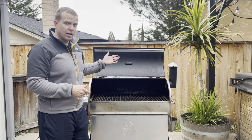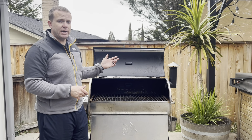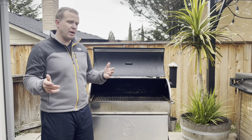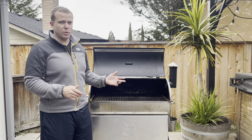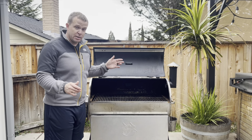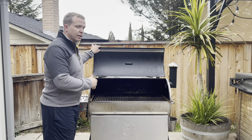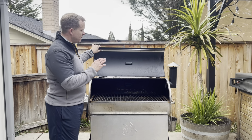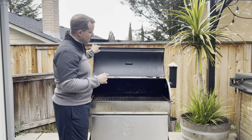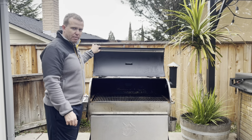But as you can see here, the RTV itself will do a very good job of holding that drip edge in place. So if you don't have a neighbor or anybody like that that wants to come over, give you a hand, one of your family members, that's fine. You should be able to accomplish this with one person. Just take a little bit of care as you're lining up that drip edge. We do laser cut these drip edges, so the holes are going to line up very nicely with the holes in the lid. And when you're pressing that RTV up there, it's kind of got a tacky glue-like texture to it. So you can get it pressed up there and get it pretty well aligned with those holes if you are managing this job by yourself.